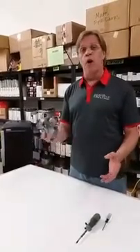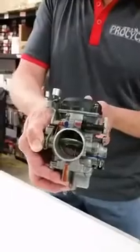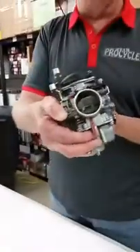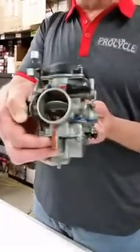It's really nothing to worry about. To understand how decel pop is created, let's look at how a carburetor works — especially a BST, one of these vacuum-operated carbs standard on the DR650 and a variety of other bikes. When you turn on the throttle, the cable is attached here and you're opening up the butterfly valve, requesting power. Nothing is really going to activate until the RPMs and vacuum pick up and the slide in the back goes up. The vacuum creates the opening for the slide, the slide goes up, and you're going down the road at full throttle with the slide all the way up.